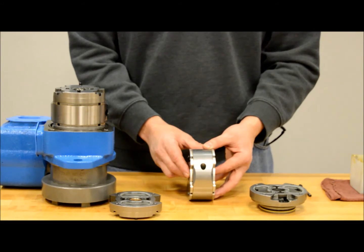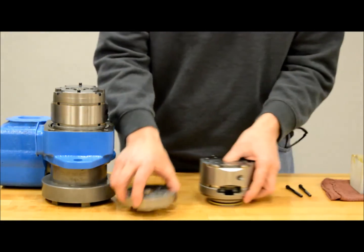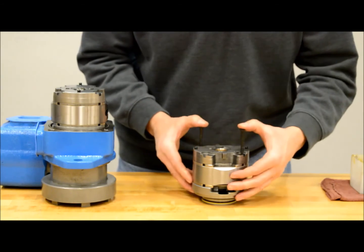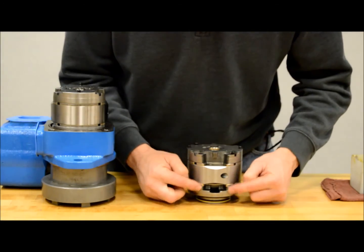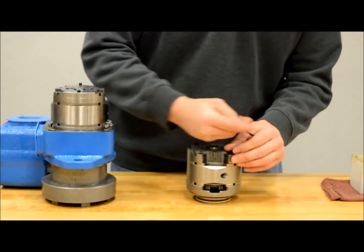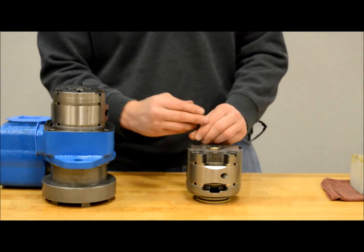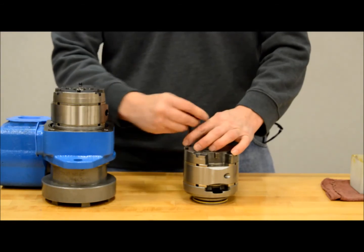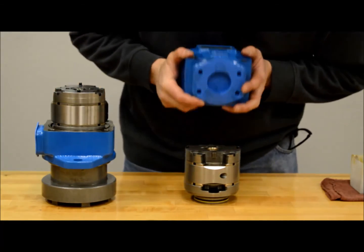After the parts have been switched around, you can install the screws and lightly tighten them. Leave them a little loose so you can align the cart kit in the housing before fully tightening the screws down. These screws are just like the V-Kit — hold the kit together during installation and it does not have to be extremely tight. Set the cart kit upright and slip the inlet housing or cover over the cartridge kit until it slides over the entire thing. When it bottoms out, you have to align the plates with the cam ring. Now you can tighten the screws.